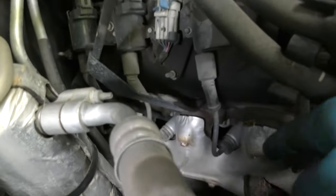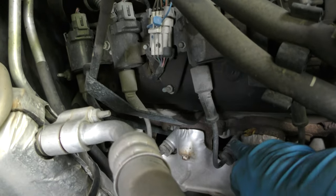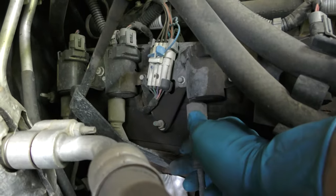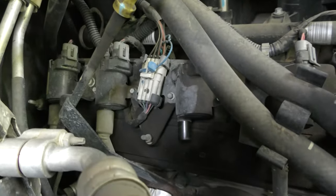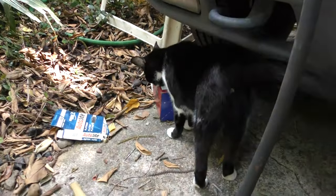Now in the Suburban when you go down you can see here's a spark plug wire coming off the coil and it goes down to the spark plug. Getting the top off is really easy — you just twist it with your hand a little, that breaks the seal, then pull down and off it comes. Even a cat could do it if they had opposable thumbs, but they don't.